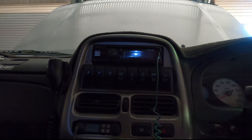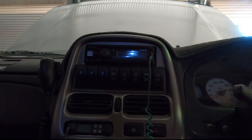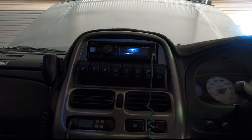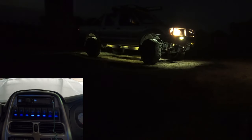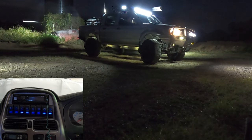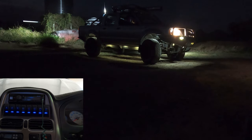Next mod is lights, because I've underestimated where we're going sometimes and ended up stuck out in the mountains in the dark just wanting to get home. I've got a monstrous panel of rocker switches with front lights, side lights, rear lights, and under lights. They obviously help you see more out on tracks, and for camping you can just pull up and flick on a light on the car. Just watch out for battery consumption - I'd recommend LEDs because they use a little bit less power.